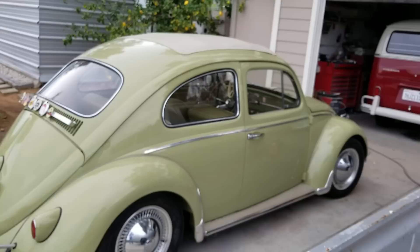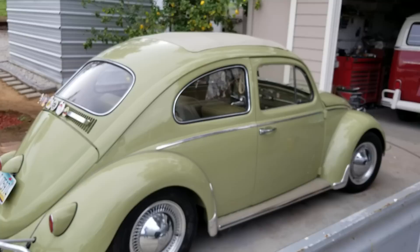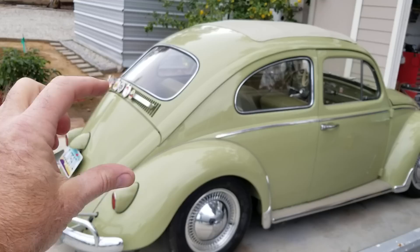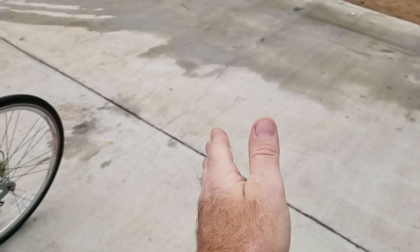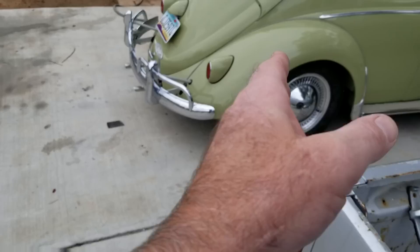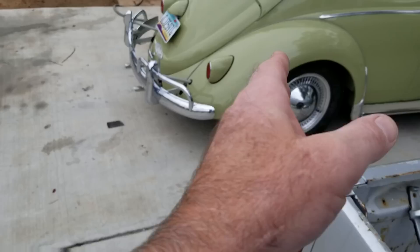So if you're using your VW as a daily driver, going to longer distance shows and things like that, you really ought to pick up a set of caster shims. All it does is you put it under your beam on the lower portion of your beam, slide in a shim, it kicks the beam forward — just like your bicycle tire how it's kicked forward. When you turn the fork backwards, it's squirrely because your caster is more to the rear. What the shim does is kick that beam forward a little bit on the bottom, and then the car wants to just go straight more.